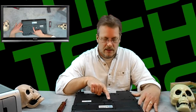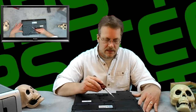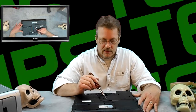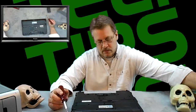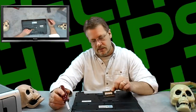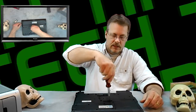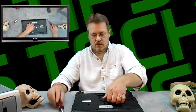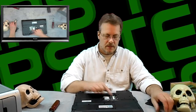If you look on a laptop, there are often little pictures representing what's underneath each cover. In this case it shows a small RAM icon — and if you remember, the RAM looks like this on a laptop. There's a little screw here. Take out the screw, lift the cover, and here's the RAM.